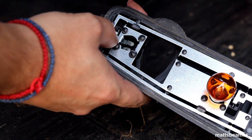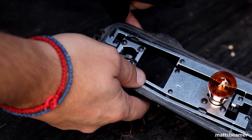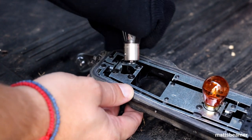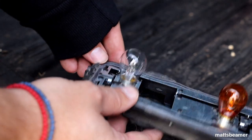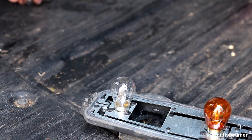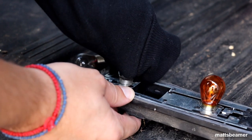I recommend that you clean up the connections to make sure that the bulb can get electricity to pass through it nicely. When inserting the bulb make sure the two pins line up with the grooves. The pin which is closer to the glass on the bulb needs to be fitted at the top of the actual light unit, which is basically closest to the tab. Now push the bulb in and turn it clockwise so it locks into place.